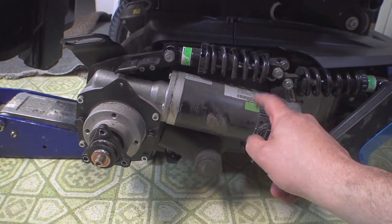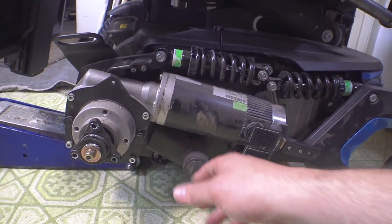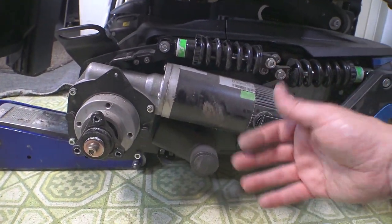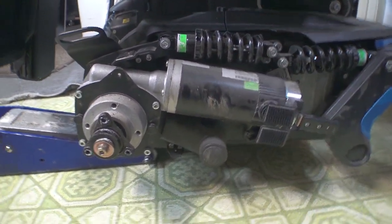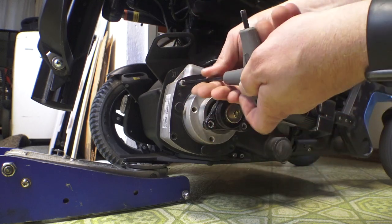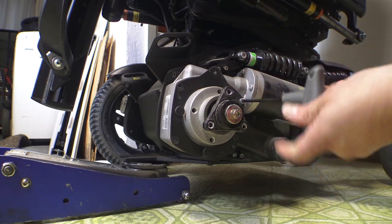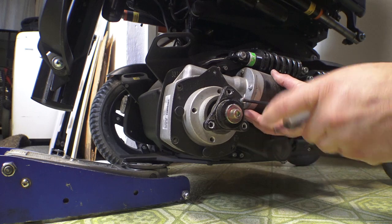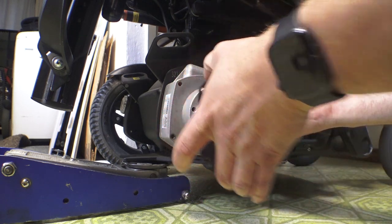We've got our two pull motors — one of the brush housings is right here and the other is back where you can't get to it, so this has to come off the chair. The wiring comes out down here. I don't really want to pull the whole back off and unplug the wiring. These four bolts hold the motor on just like in the older chairs. I'll pull those off and see if we can just swivel the motor out and let it lay. These are the same motors on the steampunk chair and on another C300 — they call this a drive unit where the gearbox and motor are built into one thing. The gearbox only has two moving parts — basically a worm drive with a giant Delrin spindle.